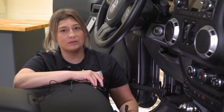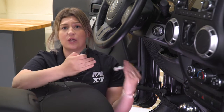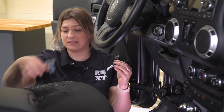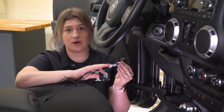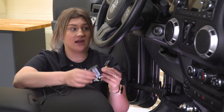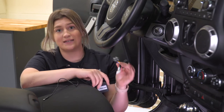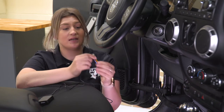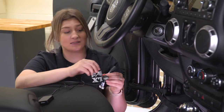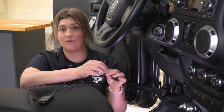This install is gonna be a little bit difficult to see, so I did want to do a little explanation on what's gonna happen before we actually go ahead and install our throttle controller. This is going to be our main control unit — it's going to plug into our main wiring harness and then into our device on the other side. We're gonna drop this below our steering wheel and plug it into our main harness before we plug our harness into the factory wiring harness. This harness is going to be a split harness — the side with the red locking tab is going to attach to the top of the gas pedal, and then the other side is going to attach to the wiring harness from the factory.